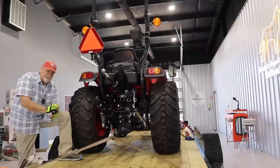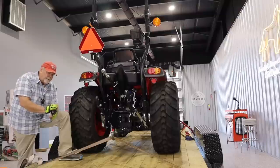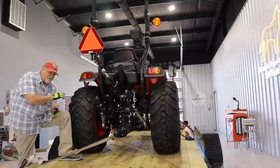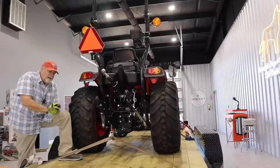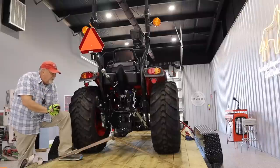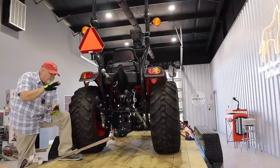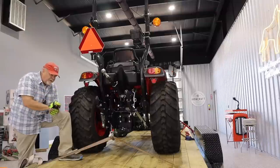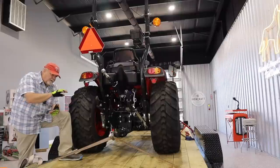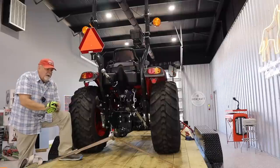And that's good braking right there. That is not having to rely on the brakes of the trailer and the truck 100%. It slows it down with engine RPM, with engine resistance. The other thing is when you're coming down long grades, resist the urge to gently brake all the way down the hill. It's better to brake a little harder, let off, brake a little harder, let off.